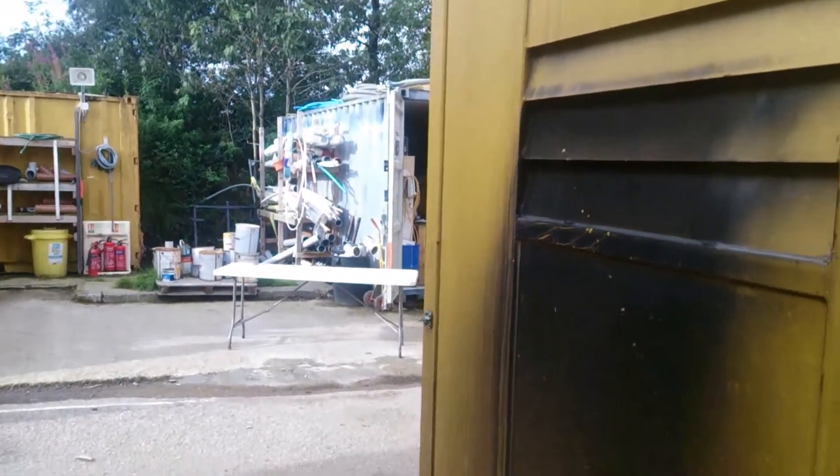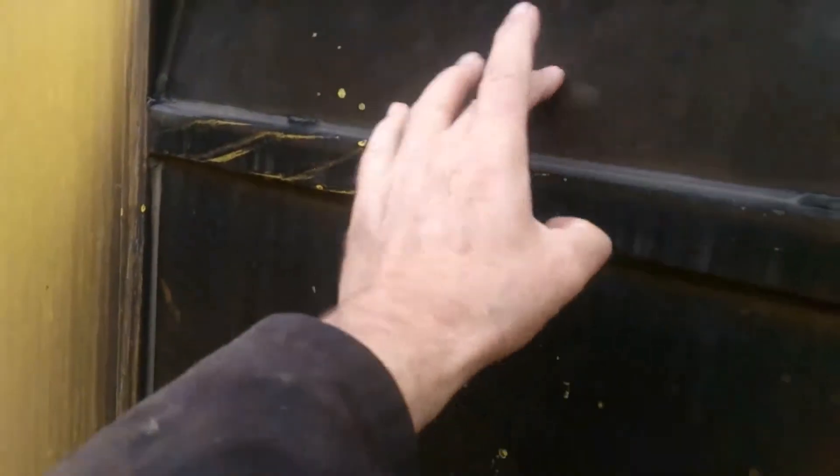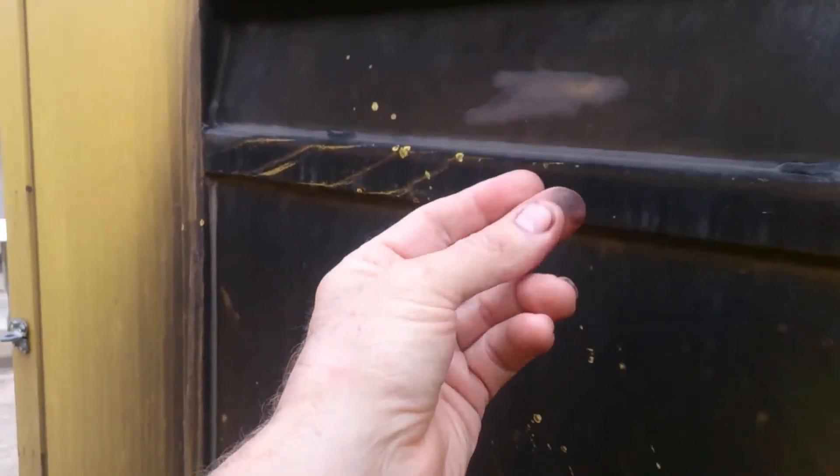This is where the radiator, if it's working properly and everything's cooling properly — this is where the exhaust air comes out. You can see there's been a lot... I mean, that could be soot, but where's the soot coming from if it's not a burst exhaust? Could this be cooked-on, burnt-on engine oil? Possibly — it would match up with what we're seeing inside the engine, which is basically low oil level and oil lying about the drip tray, in the area of the fan where it's being dragged into the radiator.